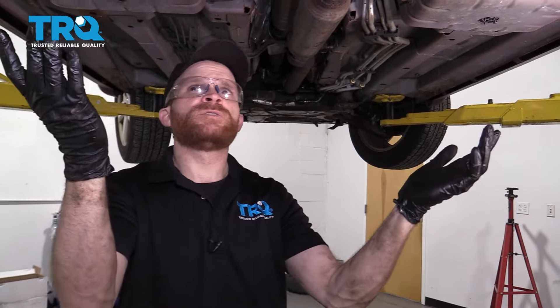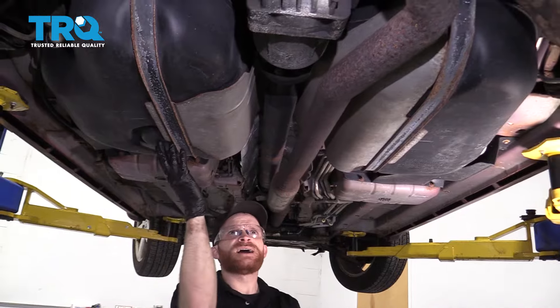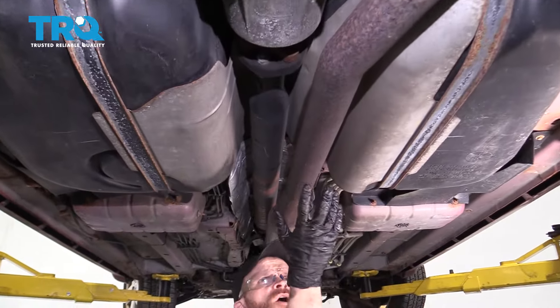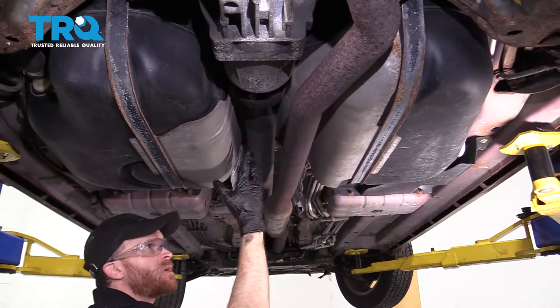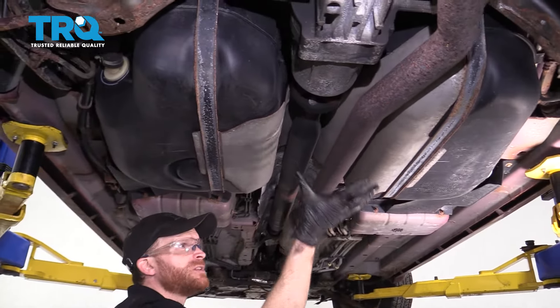Remove the wiring and make sure it's making no contact with the body of the vehicle. Now we've made our way underneath the vehicle and we can start looking at the fuel tank. The fuel tank runs from the driver's side all the way over to the passenger side — it's pretty large. The exhaust and the rear drive shaft run directly underneath it, so we'll have to get those out of the way to lower the fuel tank.